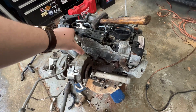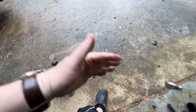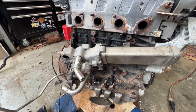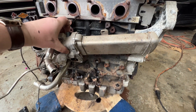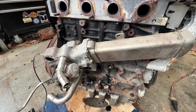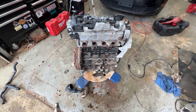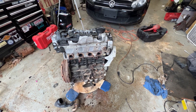About two hours later, the turbo's ready to just pop right off. Now the turbo's off, the EGR cooler comes right off. After carefully removing the EGR cooler, I think we're going to roll the motor over onto this side and see how much of a mess we can make with some oil.